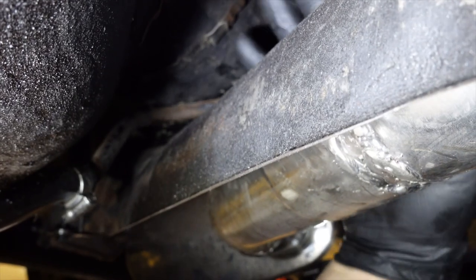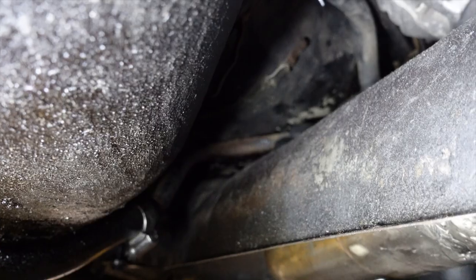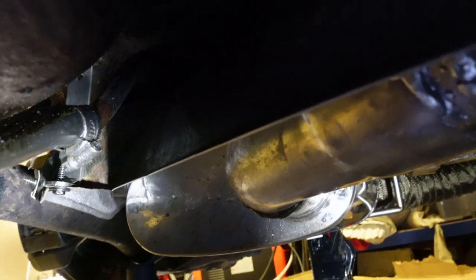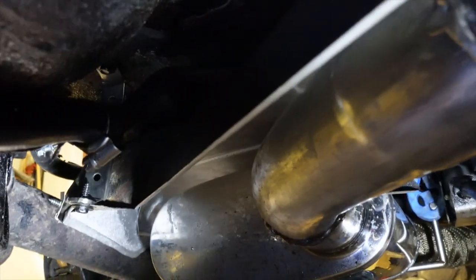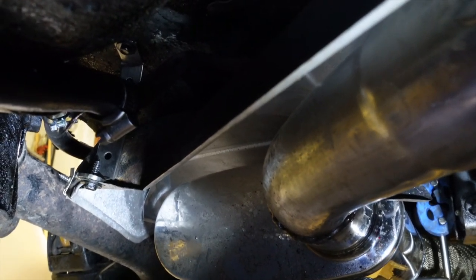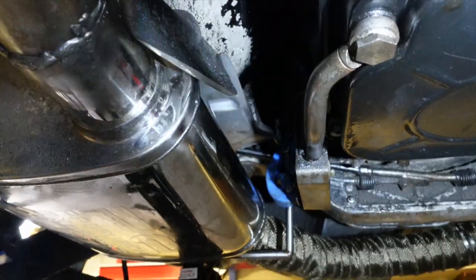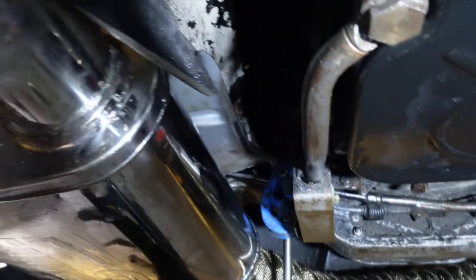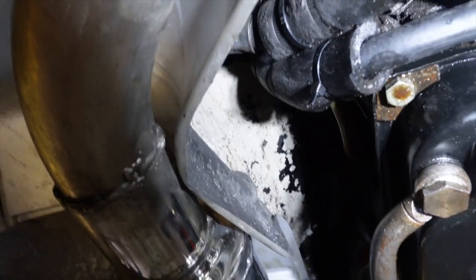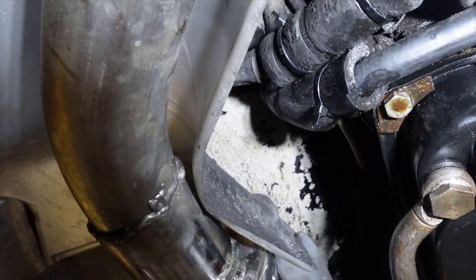Right, I've got no idea if this is my clunking, but I've got that. It's the gearbox fluid return pipe. It just taps on the inside of the body, which is exactly where I'm feeling it. So I'm going to put some sort of padding around it. I may steal a little bit off the bottom of the gearbox pipes here. If I can point to it for you, just up here somewhere, there's some protective foam that I could use just to stop it banging, and we'll see whether that fixes the problem.